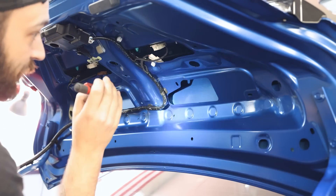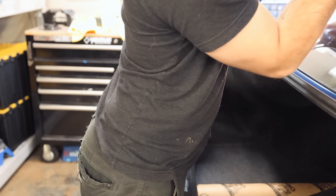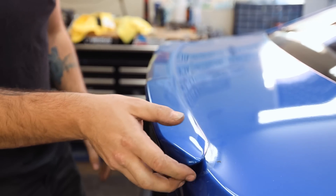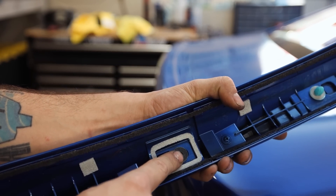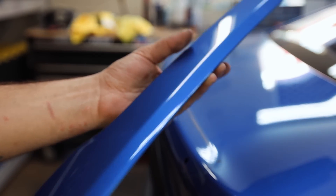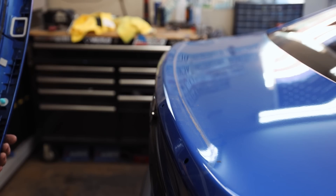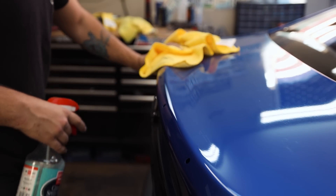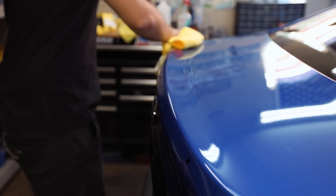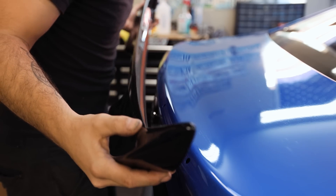At this point the wing should just pop right off. I got it out - there's actually no 3M tape on it where the 8mm bolt goes. I just put a Phillips head screwdriver there and gave it a good smack and the whole stock wing came off. Now let's get the trunk deck cleaned off, line up the new wing and see if we have to drill any holes. I'll clean it with some 70% IPA to get any dirt, grease, and wax off so the 3M tape actually sticks.